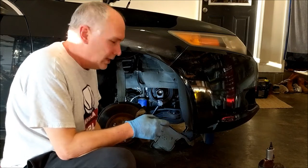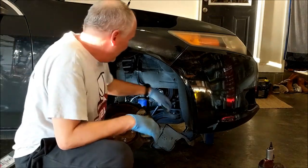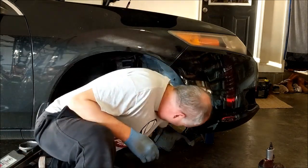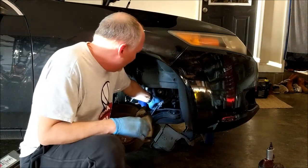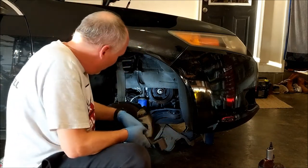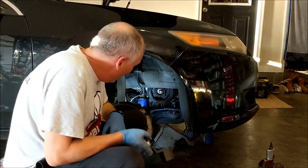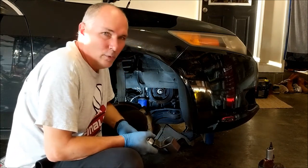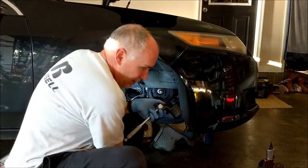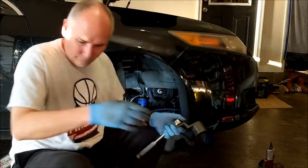You've got to get that crankshaft pulley bolt off before you can change the timing belt. I thought I'd just change it real quick, and it might not be so hard once I get this bolt off. Hondas and Acuras are notorious for having crankshaft bolts that are really difficult to get off. Here's what I've done so far: I've tried two different impact wrenches with 125–130 pounds of air pressure. No good.